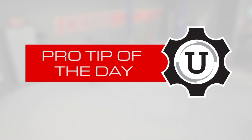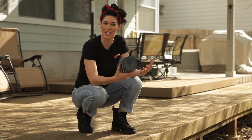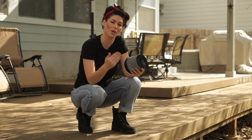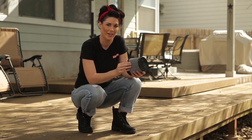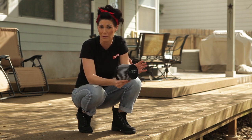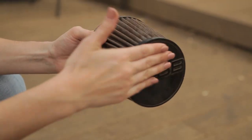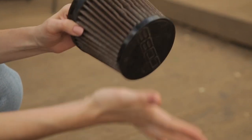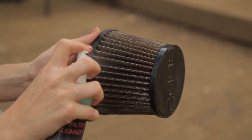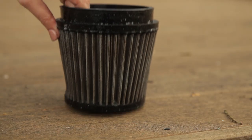And now it's time for the pro tip of the day — let's talk filter maintenance. If your filter is all gunked up, your car can't breathe deeply and as a result you're going to lose a little performance. So you're going to want to routinely clean and re-oil it. Your mileage interval will depend on how dusty it is where you're located, but we typically recommend every 10 to 15,000 miles. To clean your filter, first knock loose any debris that may have accumulated. Next, douse the filter in our cleaning solution, spraying from the outside in, and let it set for about 20 minutes.